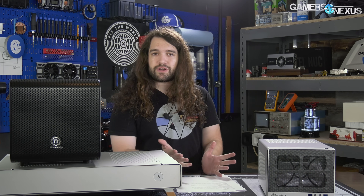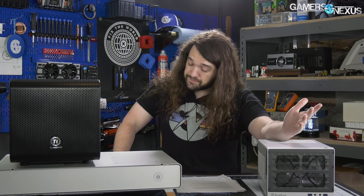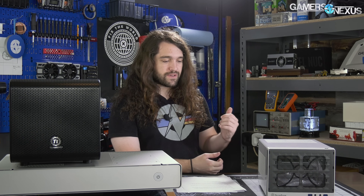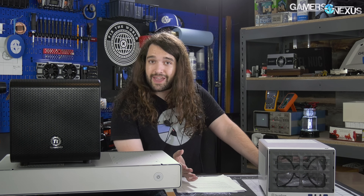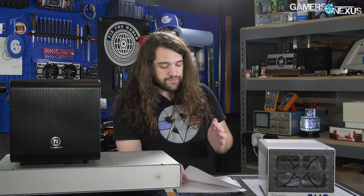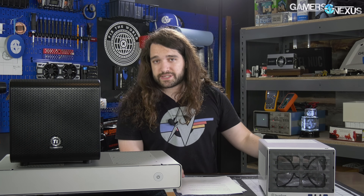The V1 is the most versatile and the ease-of-use winner — easiest to build in, most cable management space — but it's not that small. If that size is acceptable for you, it's a fine case and one of the better ones Thermaltake has made in recent years. The SG13 is also a fine case but harder to work in, with way less cable management space and potentially thermally constrained scenarios. However, it performed exceptionally well — better than the V1 in most of our tests. If you configure it mindfully and keep cables out of the way, you'll be fine. Cable management in cases like these can actually impact airflow, unlike on ATX cases where it's mostly inconsequential — ITX has way less volume to work with. We want to know what ITX cases you specifically want to see tested — leave a comment below and we'll try to acquire them.